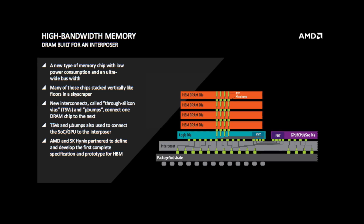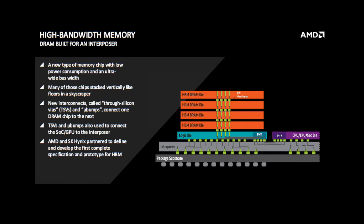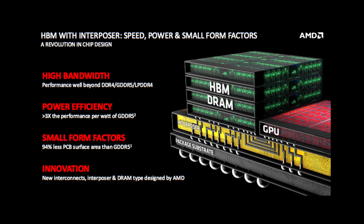HBM is going to really make games faster. It's a new type of GPU memory that vertically stacks memory chips like floors in a skyscraper, shortening your information commute. Those stacks connect to the GPU through an ultra-fast interconnect called the Interposer. Several stacks of HBM are plugged into the Interposer alongside the GPU, and that assembled module connects to a circuit board. Even though it's not on-chip integrated memory, it still runs so fast due to the Interposer that it's indistinguishable from that type of memory. The memory interface is also something not to scoff at — no longer a 256-bit or 512-bit interface, but now a 4,096-bit memory interface, which is simply incredible and should make the card run faster all around.